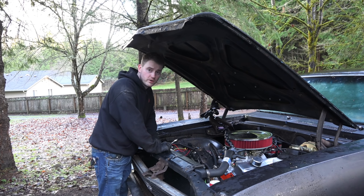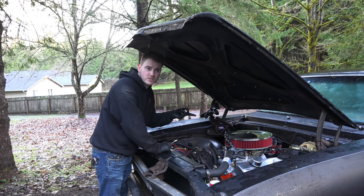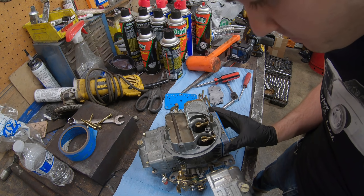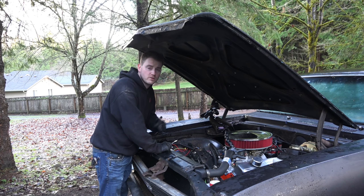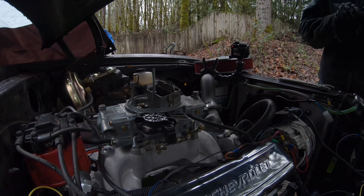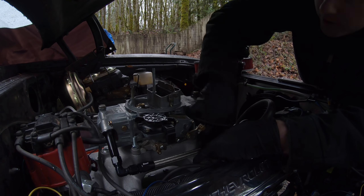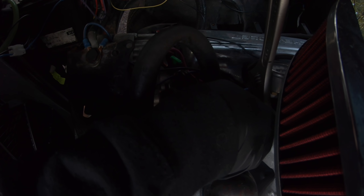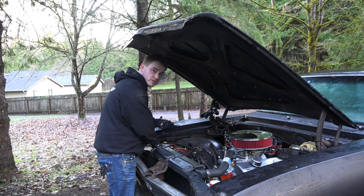This thing was also running pretty lean during our test drive, so I put a secondary metering block in it. The plate that was in it was a 21, which is equivalent to like 74 jets. Most vacuum secondary new 750s are going to have 72s in the fronts and 82s in the rear, so I put 80s in the back and it already had 72s in the front. Then I put a four-window power valve in it, which is another thing you see on a lot of new 750s. I also changed out the hard line setup with a braided hose setup so that whenever I need to change jets, I can easily pull the bowl off, set it to the side while it's still hooked up, and not have to loosen a single fuel line.